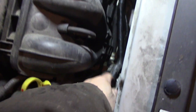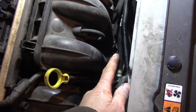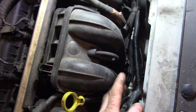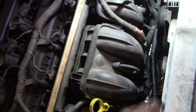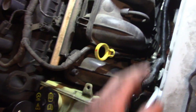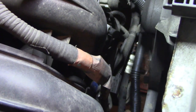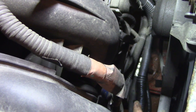That's corrugated, kind of like plastic, not rubber. Trying to think of the best way to do this - if we can mend it with just a nipple going into each end, like you would mend a garden hose, that's probably the best option. I don't know if this material allows that but I'll try anyway. My problem is the coolant level - if we clip it, how much is going to come out, and it's kind of high. I need to get a bucket. Maybe we can get the hose up here, but if it's cracked it's probably brittle anyway. Let me look up how much this part is.